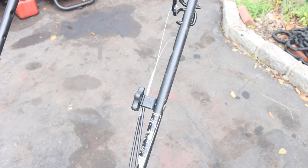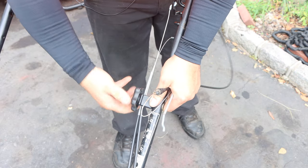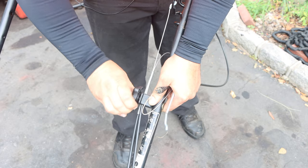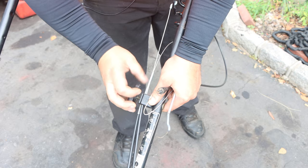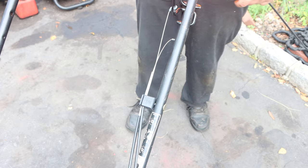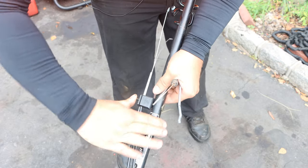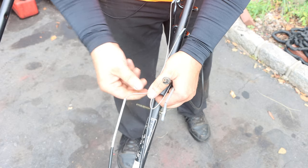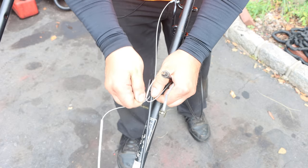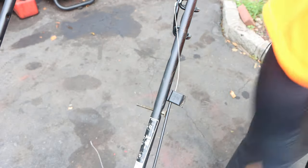On this particular model Toro — not the one I took this cable off of — you don't need the 7/16ths. We just need to turn this out. Lefty-loosey, righty-tighty. This has to come all the way out. Stick that in our pocket. Just pull this cable through and the string up and out. We are done.